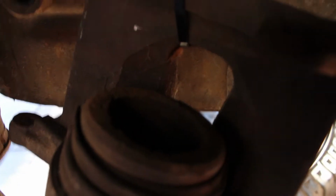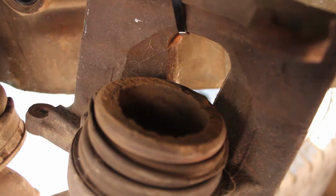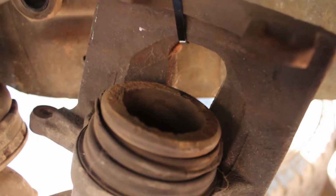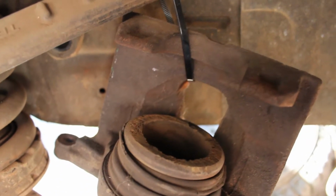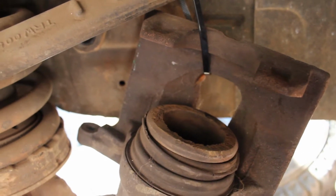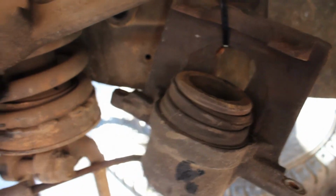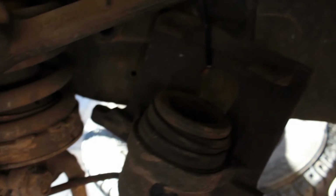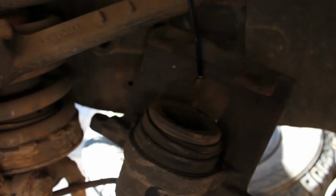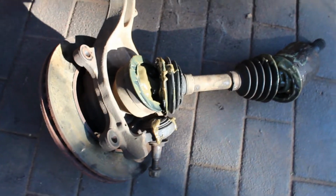On this side, I did notice that this brake piston also looks pitted and broken. So comment below if this is a Jeep thing, because I've never experienced this, and it's weird that it would be on both sides at the same time. The same goes for this side. New upper ball joint needed, and probably new calipers. And here's the whole hub with the CV and the disc.